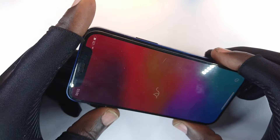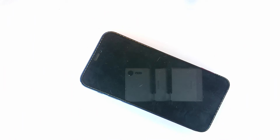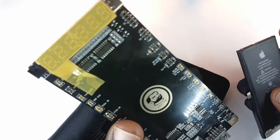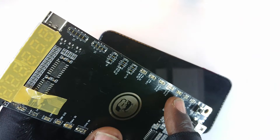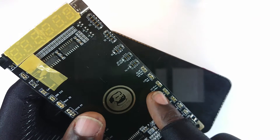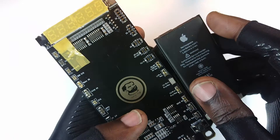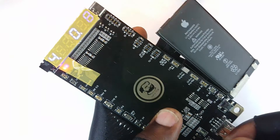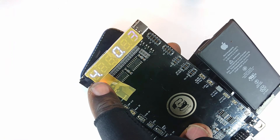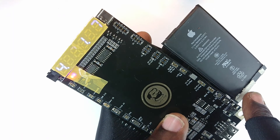Something told me, let's first check if the battery actually works. I have this device — this thing helps me with waking up dead batteries. When you look at it, it has demarcations on here. This location is for the iPhone 12 Pro and mini. I plug the battery in and give it power from the charger — it will glow and show me the voltage and charging current.